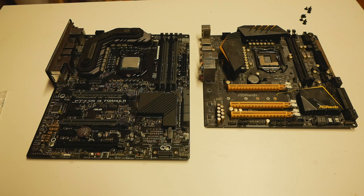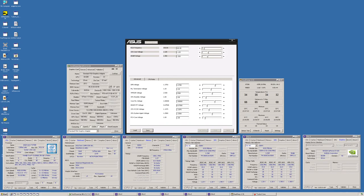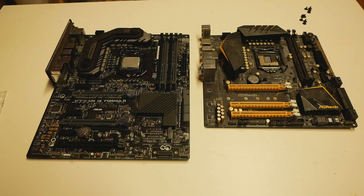Many managed to do some kind of modifications to their older motherboard BIOSes to support the newer CPUs, but there were a lot of downsides back in the early days, which weren't present on the ASRock OC Formula Series boards. It was a very common issue that you couldn't run hyperthreading with the i7 CPUs like the 8700K, and there were overclocking issues, so you couldn't really overclock the CPUs at all, and could run them only at stock.